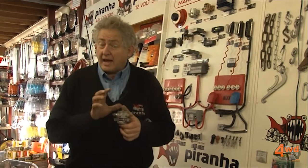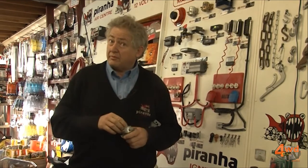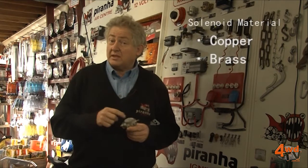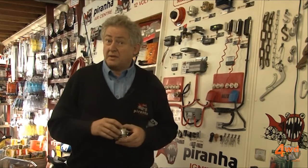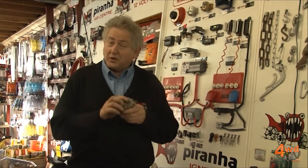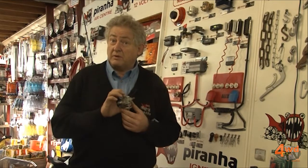That's a standard ordinary solenoid. Solenoids are made in different ways using different materials — you can get copper contacts, brass contacts, pure silver, or even silver alloy contacts. The advantage of better quality contacts is more conductivity and therefore a better connection. Unfortunately solenoids are mechanical, they physically wear out, and like this one it got full of water so it corroded. Solenoids also create enormous voltage spikes, so they're not suitable for use on most modern vehicles.